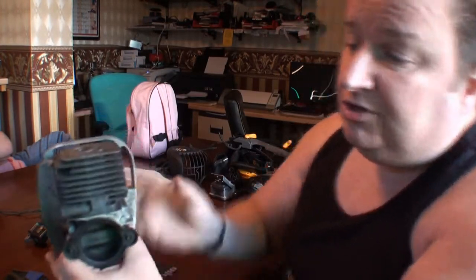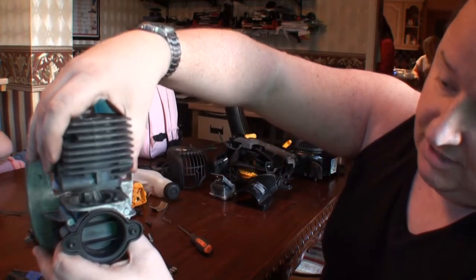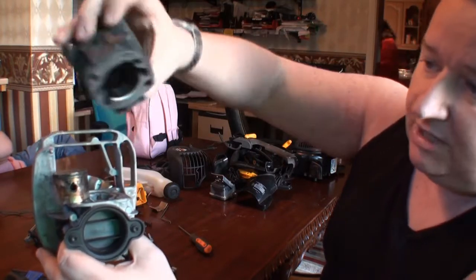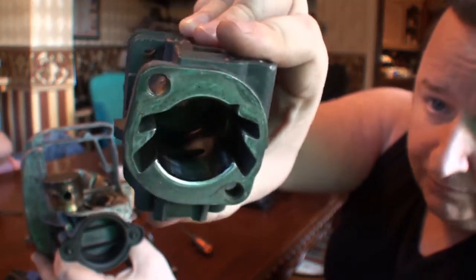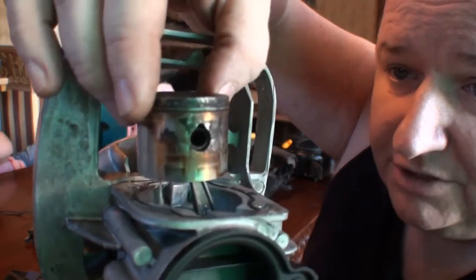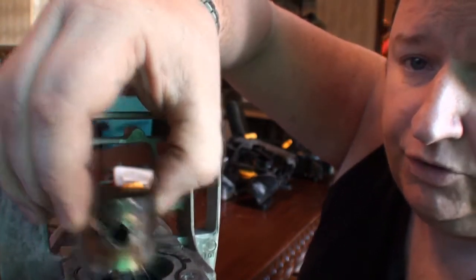Once I actually stripped the engine down — this comes with the barrel and the head welded as one piece, normally you'd have a separate head. As you can see, I've just taken the barrel off. That's the piston, and it is very, very loose. When you look into the barrel, it's all scored, and there's been some blow-past as well — it's browned down the barrel. This is the actual piston and ring that goes thousands and thousands of times up and down in this little two-stroke engine.